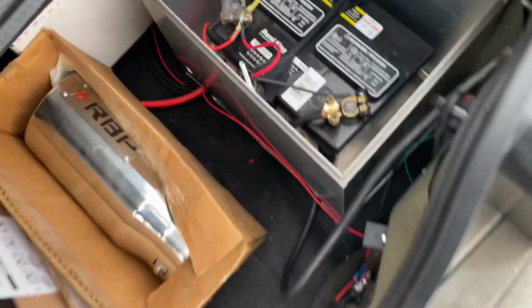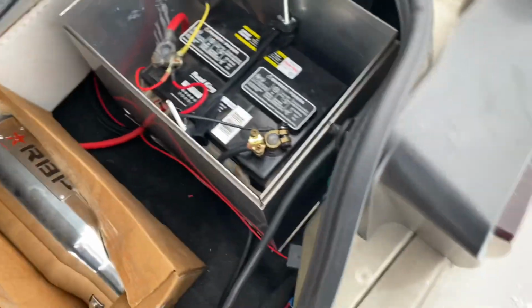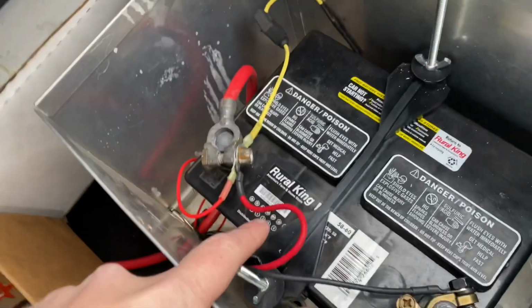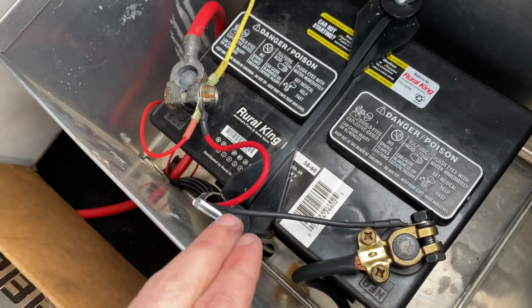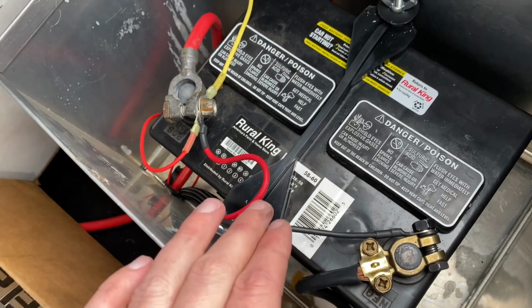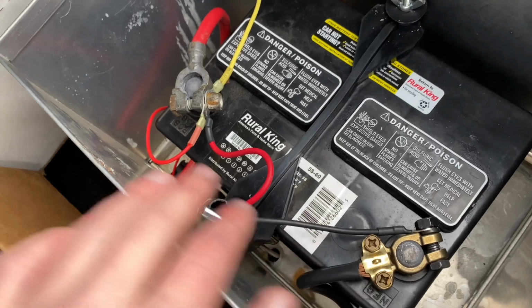Obviously, if you had the battery in the front, you wouldn't run all your wires back here, you'd run them to the battery. But for this, you have a main red wire and a main black ground wire that connect into their own spot on the ECU. The Holley instructions tell you that those wires have to be connected directly to the battery. There's no substitute. So be sure that you mount those there.